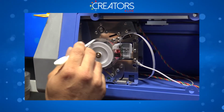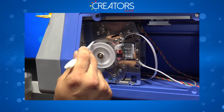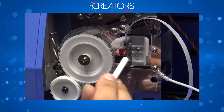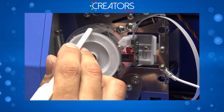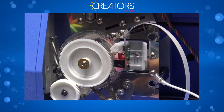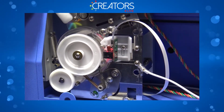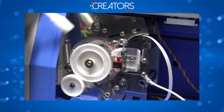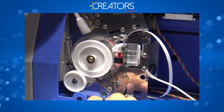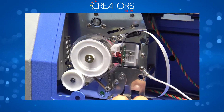And as you can see right here on the front, it's nice and shiny. But if you notice right here on the very edge, you cannot see through. Those are the lines that the sensor reads, and these are the lines that need to be cleaned. So what I like to do is grab my swab, spray a little bit of alcohol, not too much, and then very carefully press it against this metal plate. Press it and then slide it behind the disc. Let me go grab my flashlight.